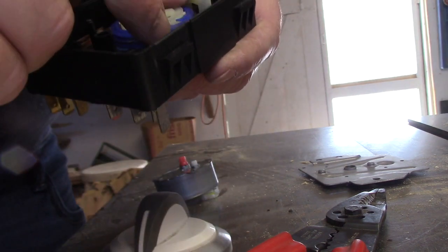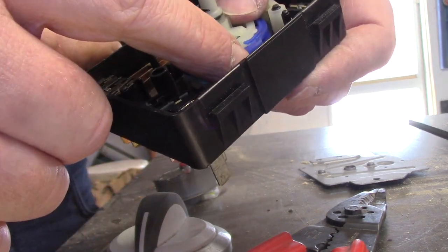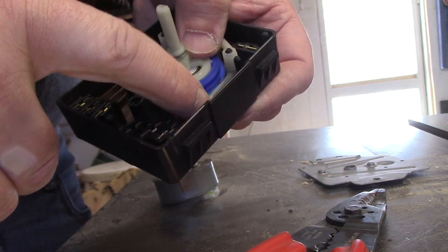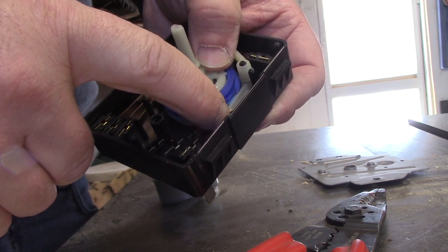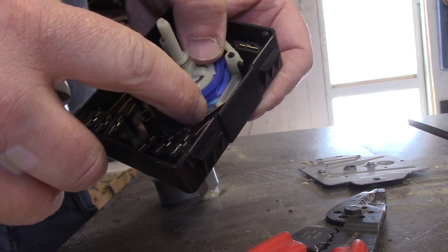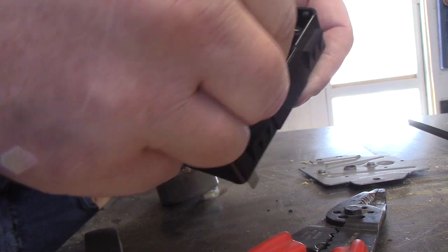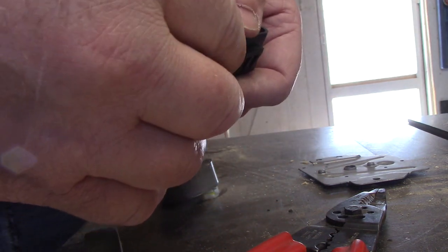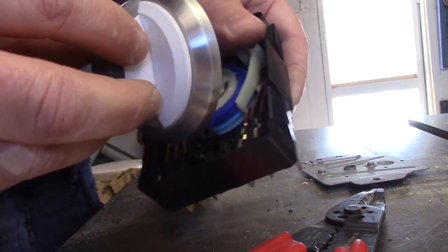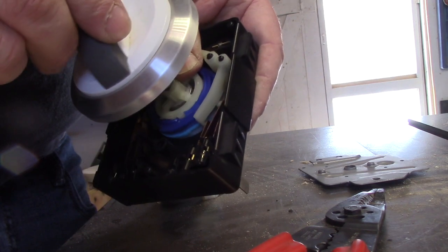Okay. Yep. So now in the neutral position, this contact, this contact, this contact are all loose. As I roll forward, these three now come together. Nice and stiff. Pushing on it good and hard. Everything looks hunky-dory there. So now I just need to drop this cam back down in. Make sure I wiggle it back so it drops into place. And then that can activate this lower one, pinching those two together.